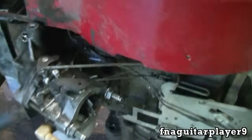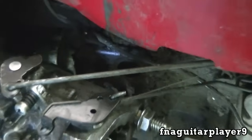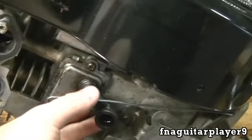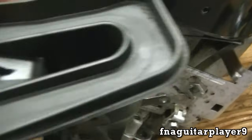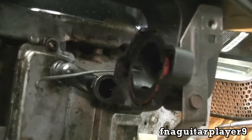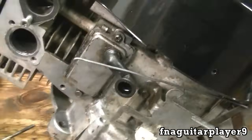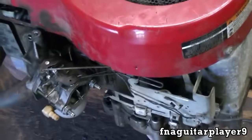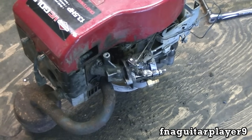I'm not putting the air filter assembly on — just going like this to test, because I'm putting this carburetor right back on the other engine. Down here at the valve cover there's a hole for this little oil breather tube — it hooks right on there. When you put the air filter assembly on, it hooks in like that. You want to make sure it hooks up because that's your crankcase ventilation. Since I'm just testing, it doesn't really matter — it doesn't affect performance, that's just a regulation.